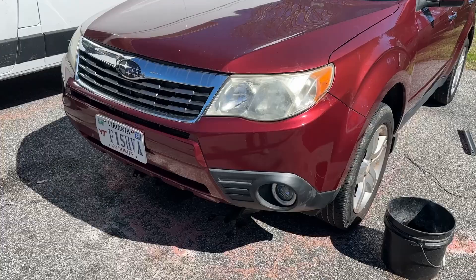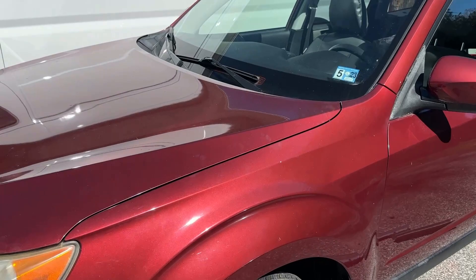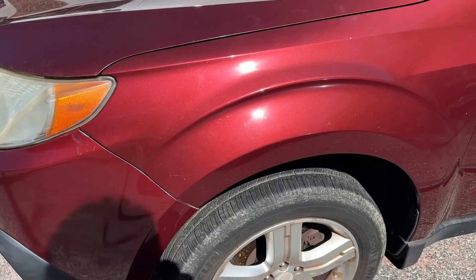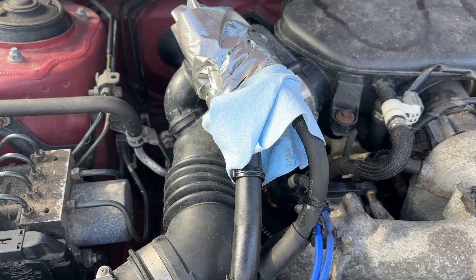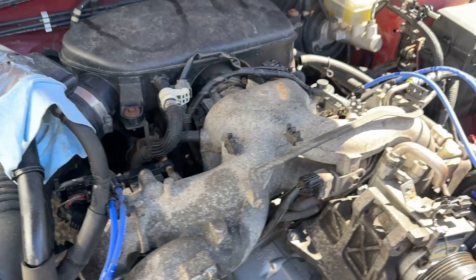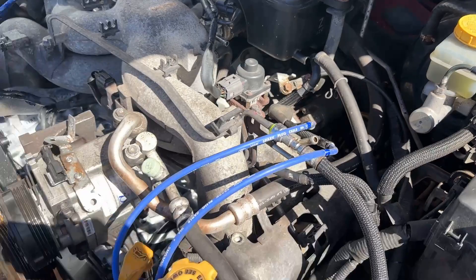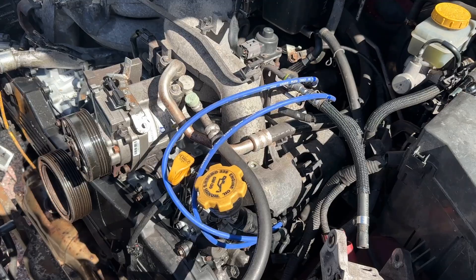Just got back to the Forester. I want to get all underside things done first — tightening down the bell housing to transmission, making sure that's all good before I start putting electronics on this side. Passenger side electronics and spark plugs are all connected. Engine and transmission have a good connection on that side. On the driver side, I want to make sure everything is connected and good to go. Starter's sticking out a bit so I'll make sure it's secured all the way. Then I'll hop underneath to secure the exhaust and engine mounts.